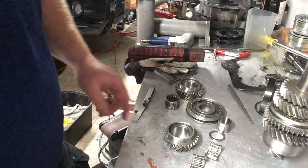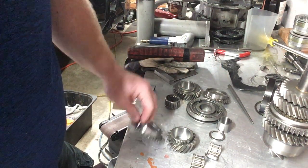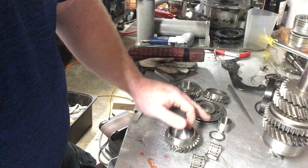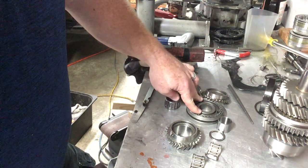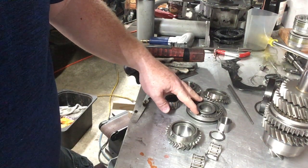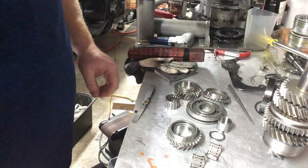This is going to be a quick mock-up of the 091 Weddell main shaft assembly. They've got their racing gears and floating hubs — these are floating hubs for 091 Syncros. I think those do get better shifting. You do kind of maintain the 091 3-4 clips, which have their problems, but the 091 Syncros are stronger. I think especially the 091 slider with the 091 clips shifts better.